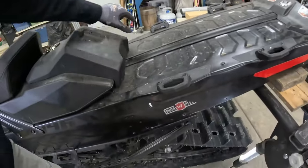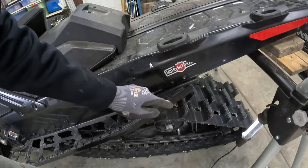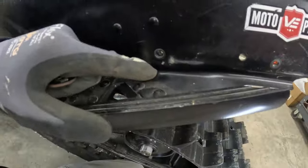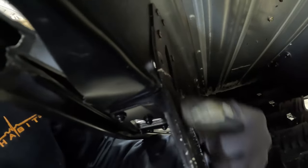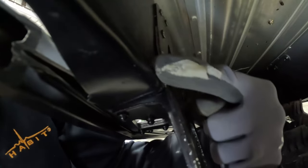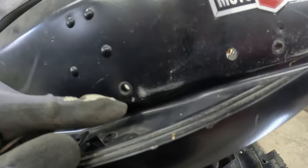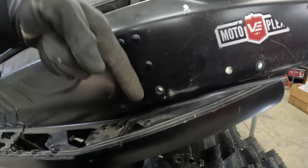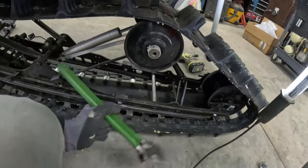I've taken off the clamps and the boards so you can see it better. I've already tweaked on it a little bit, but you can tell that there's a crease right here that I'm going to have to get out so that this bracket will actually sit flush with the outside tunnel. That's probably the hardest thing right now. I've already pushed the bow back with those clamps and I've been bending this back with this great big crescent wrench.